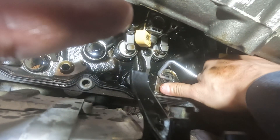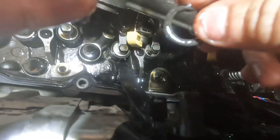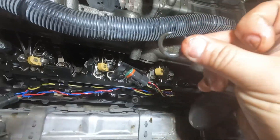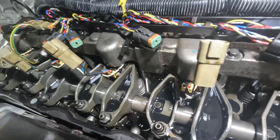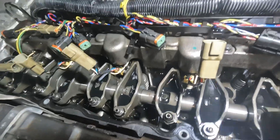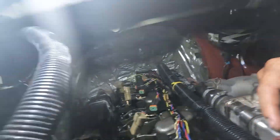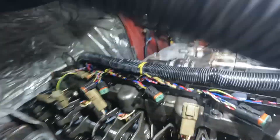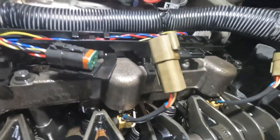I'm going to replace this O-ring as well as all the injector O-rings, which come in a kit — it's an oil rail seal kit. We'll retest it and go from there. I got it resealed — let's retest it. I don't see any more leaks. Looks like this one's good to go. I'll reassemble it and road test it, and that'll be it. If you enjoyed these full length videos, make sure you give it a like, comment, and thanks for watching.